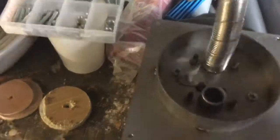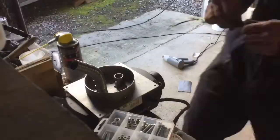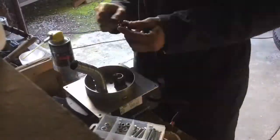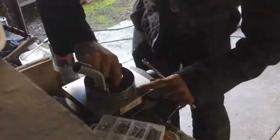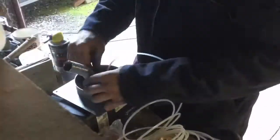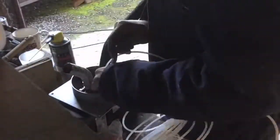I've opted to replace all the nuts and washers. The washers are spring washers and you don't have to over-tighten them — just enough so that they're not going to loosen. With the fuel lines, it's a case of putting a rubber hose on and then the main fuel line is a rigid pipe. I'm going to do a little bit of a tutorial on the fuel line installation in part two of this video series, so make sure you check that out for more detail.